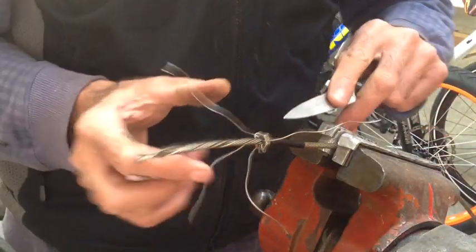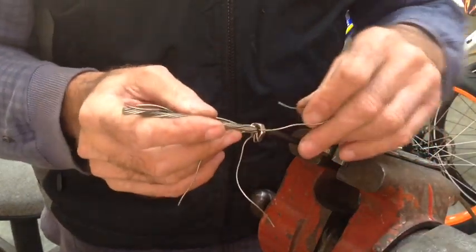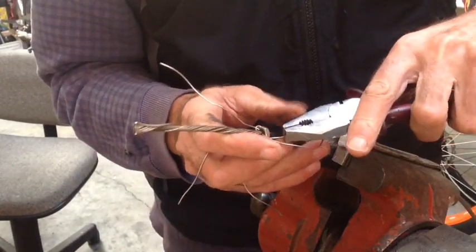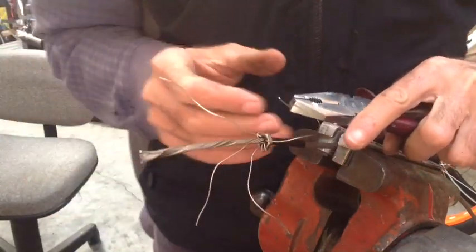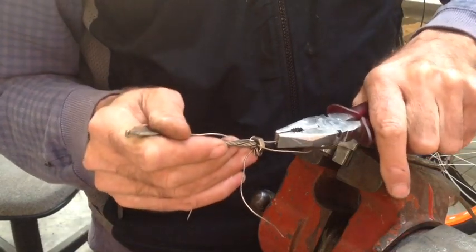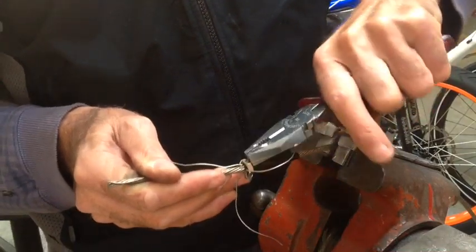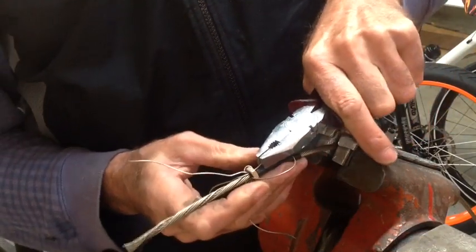The reason I'm going this way is that the pipe is dry inside and it's just not oiled up. So bringing oven cleaner in there — I don't think that's really the way to go with this one. I'd rather clean out a lot more at once instead of oven cleaning, and I don't think there's much oil or carbon in there to clean out like that. Also, I'm not that interested in cleaning out those perforations. If those perforations stay blocked with rust or whatever, that's good by me — it's just an interference to the pulses going back and forth. So the perforated lining in there can stay blocked as far as I'm concerned.